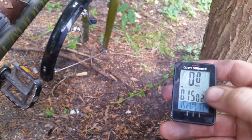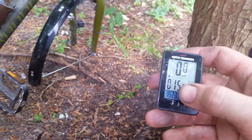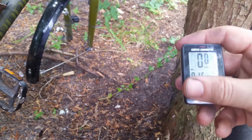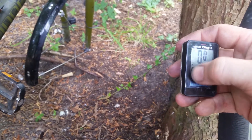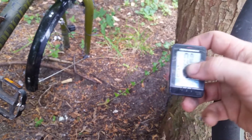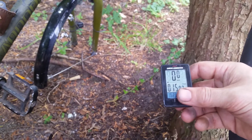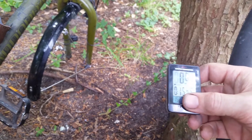It's becoming erratic. One issue is if you go 30 km per hour or more, it shows something like 6, 7, or 11 km per hour. The backlight has also stopped working. It's a sort of bluish-green backlight. Several months ago there was a black blob in the middle of the screen. Now almost the entire screen is black — at the edges you can see some blue-green, but anywhere else just black. I tried to make a video last night but it doesn't really show up on the phone camera.